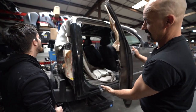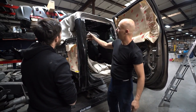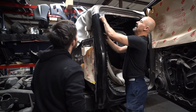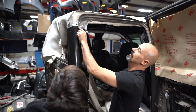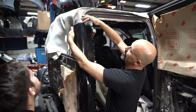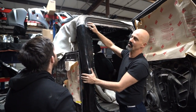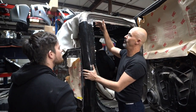We know that we've established a good door gap. We're checking our pinch weld all the way around, making sure we don't have anything crazy going on with any of the inner structure. And then we're also taking a look, now that we have our sleeves in, at our root gap, which is where we're welding the two panels together. The gap that's in between the two panels is a root gap. So now I'm going to go through and make some adjustments anywhere that it's overlapping so that I've got a nice even 1 to 1.5 millimeter root gap all the way across it.